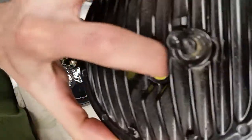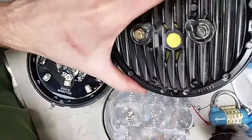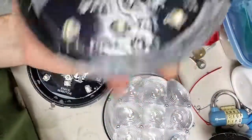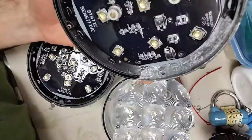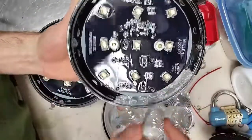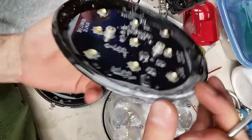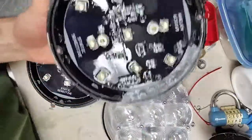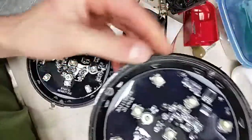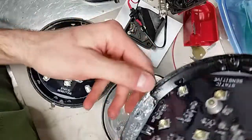That's the only foreseeable solution. I'm still not sold on the microporous vent at the back — I'm probably going to gob that up with silicone too. I would stay away from these for that particular reason, and if you are experiencing this problem, that's the solution: scratch along here to break the seal on the paint, then touch up with some spray paint to seal it all up, cut around, reapply silicone so it sticks to the exposed aluminum and not the paint.